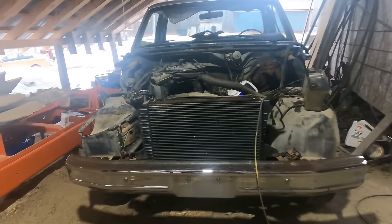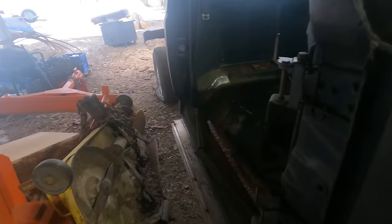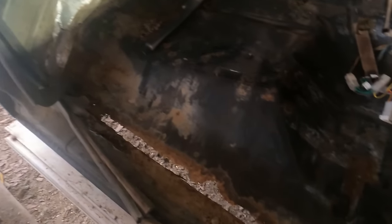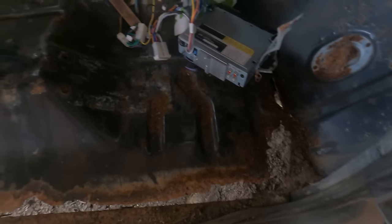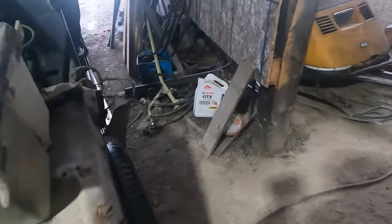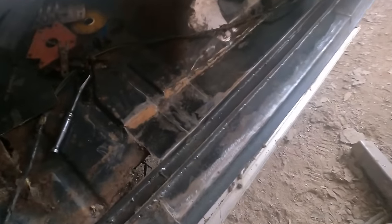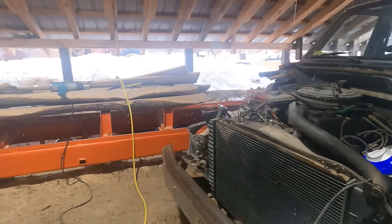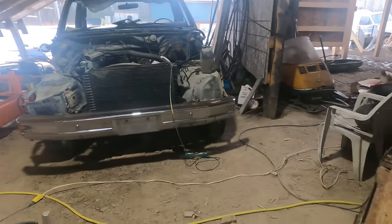This side here is not as bad as the other side, but there are pieces underneath I have to weld and I don't want to weld from up top. So it all has to be welded from underneath. I'm cutting everything out that looks bad — all new metal going in. I'm not messing around with old rusty stuff. I have good metal around here, it's a sixteenth of an inch. Once I prime it and paint it, it'll last — probably the rest of my life. The truck's 40 years old now; I'm sure I'll get another 20 or 30 out of it.